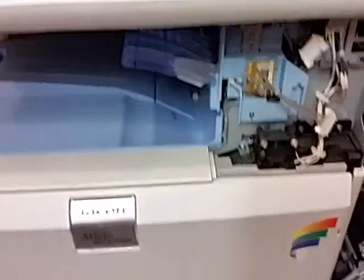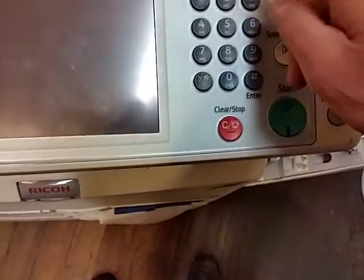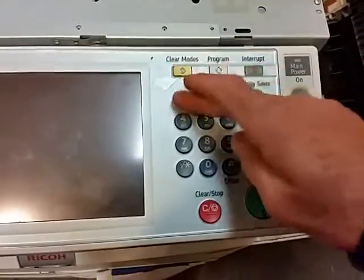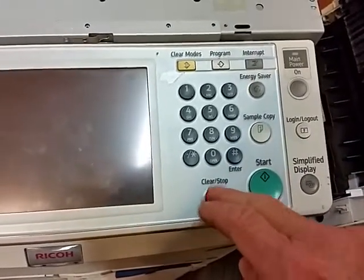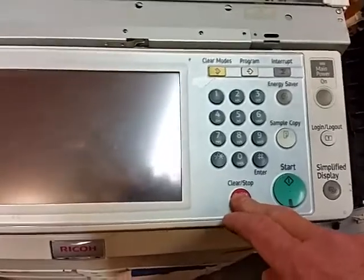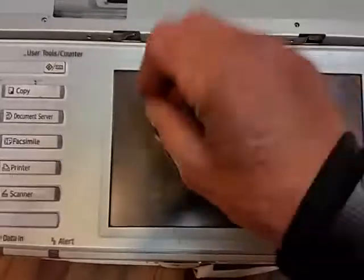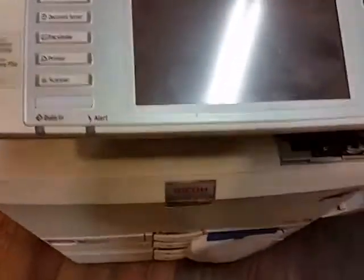Now, once you get it back in, you might have to calibrate the screen, which there is another video on that, but just for real time saving, it is clear 1993, stop 1 2 3 4 5, and hold, and then you'll see the touchscreen change, and then you'll hit calibration, and then there'll be two little dots and you touch those. I suggest doing it twice, and then that will calibrate your screen for you, and then you'll be all set to go.